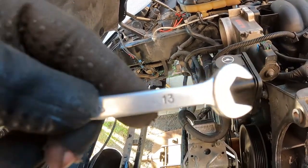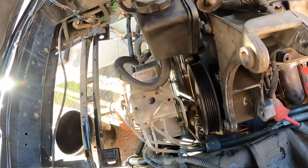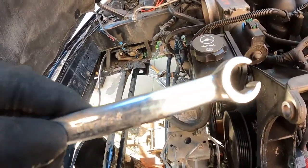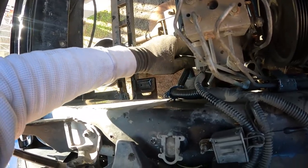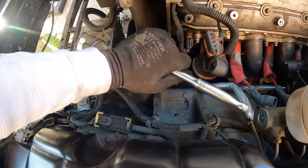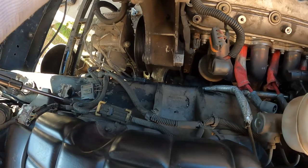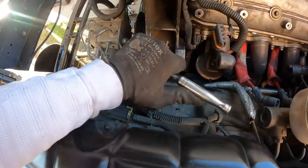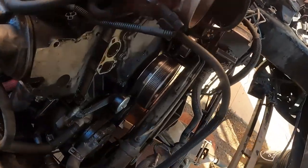To make it easier, I loosened up the ABS module — on some C5s it's in the back on the differential on early models. Loosen those two bolts and you can move it around. Since the radiator is out, you can access from the front too. Get the top bolt out first, then the bottom one — especially with the alternator out, it makes life way easier. There's a bolt holding the steering shaft onto the rack and pinion — 13 or 12mm — remove that and move it off to the side. Do not turn your steering wheel after this because you can break your clock spring, which operates your airbag. Then take off the ABS bracket — two 13mm bolts — and the remaining 18mm bolt mounts the rack and pinion: one on the driver's side and one on the passenger side.